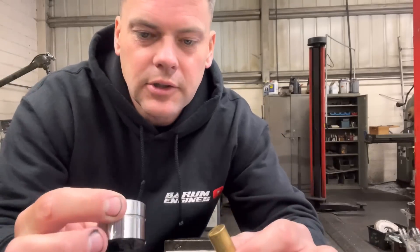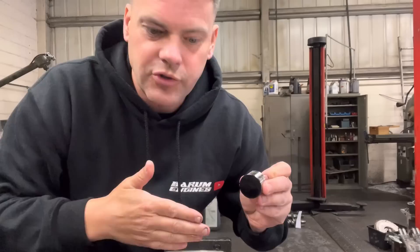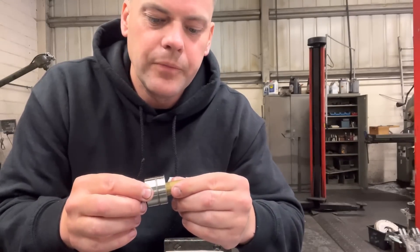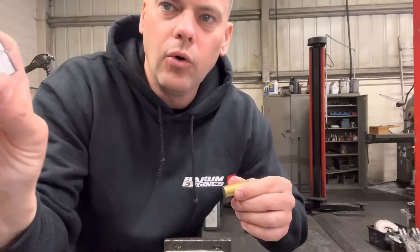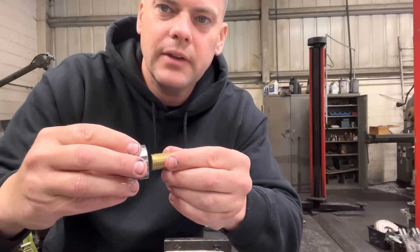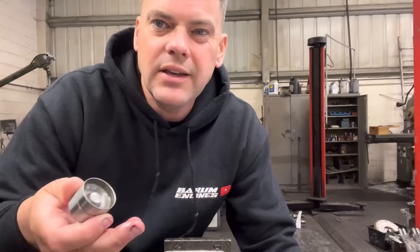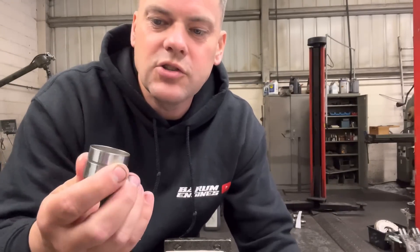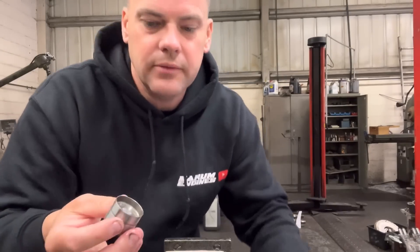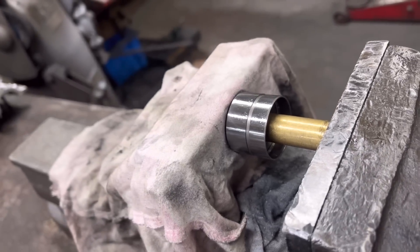I've got a piece of bronze here which I use to push on the plunger. We then use the aluminium soft jaws and some cloth so we don't damage the face. What we do is we just wind it in very slowly with the hole facing downwards and you see the fluid come out. Then what you do is you release it and it will jack itself out, fill with fluid again, then you push and squeeze out. You basically do it until it's squidgy - just the spring doing its job and no more fluid comes out. Just squeeze in very gently, you can see the fluid drip out.